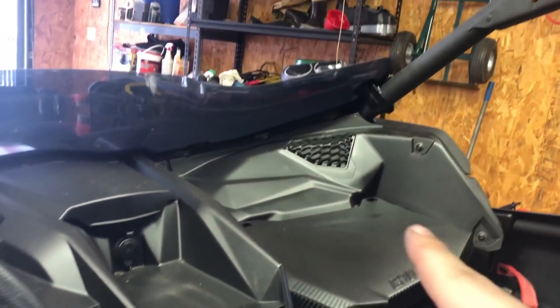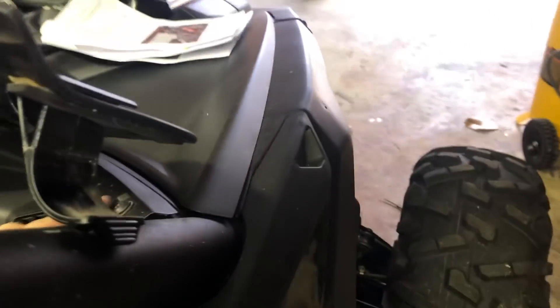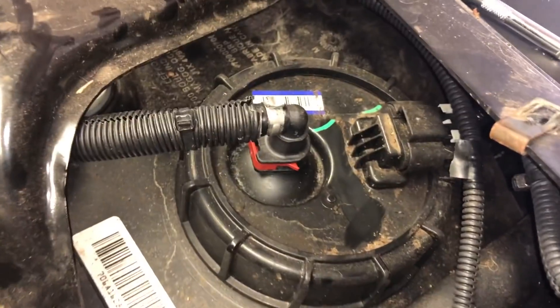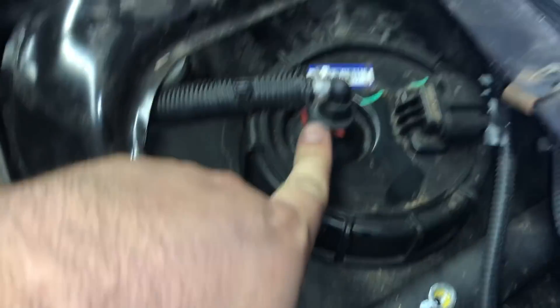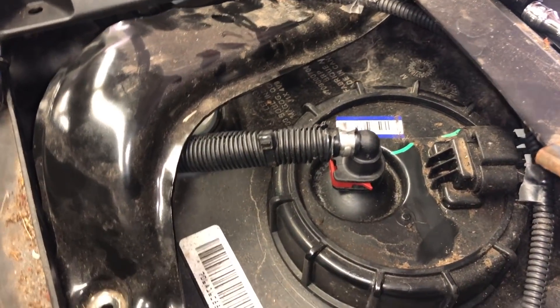We have other things we can do — go ahead and knock out the fuel pump and then the charge tubes, which should be pretty easy. The hardest thing will just be getting to everything. We got to pull off the plastics around the fuel tank — the tank is right here. Pull this windshield off and get right under here. Looks like we got a T30 Torx and a few pins, and that should be enough to get access. I'm gonna lay down a towel or paper towel here since fuel gets everywhere. Pull this clip off, pull this one off, then this whole unit comes right out, and we drop the new one right in.